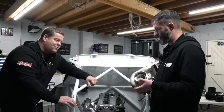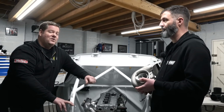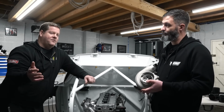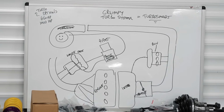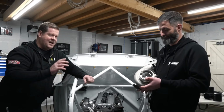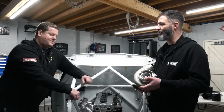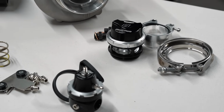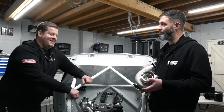To be honest, the wastegate one is a really interesting channel to log. Because you kind of know when you're exhausting off excess boost or when all the air is actually going through the turbocharger. And you can work out how big it is and where it meets in the RPM range. So that will be a good channel. Definitely. We always say data's king. The more data you have, the more you can use, and the more efficient you can make it. 100%. And to be honest, it's just more wiring as well, isn't it?